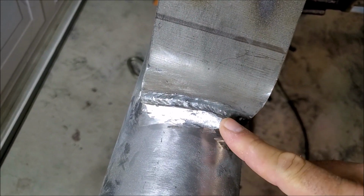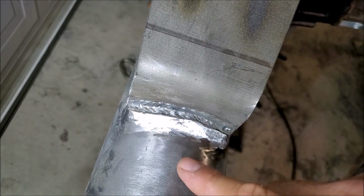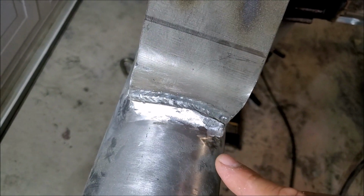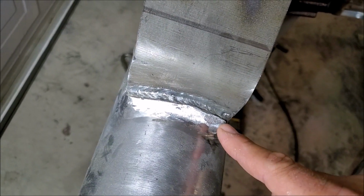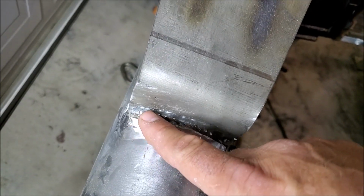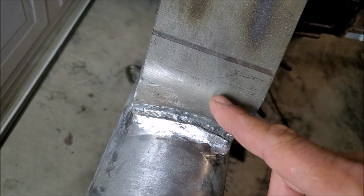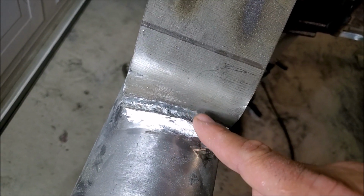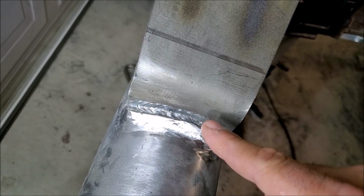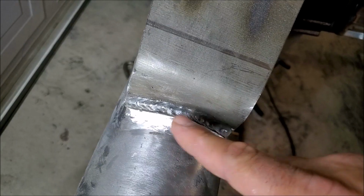When you're using your typical home welder and you're welding thick material like this, it's always wise to do multiple passes. I see a lot of guys break out their Miller 211s and do these really pretty stack of dimes welds with it, usually with .030 wire, and it looks beautiful. But to tell you the truth, on thick material like this, they're probably not getting any penetration or fusion. So resist the urge to make really pretty welds and make strong welds. Do multiple passes.